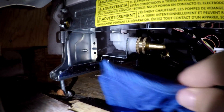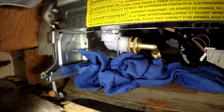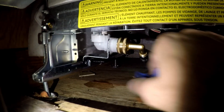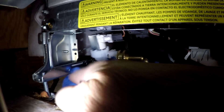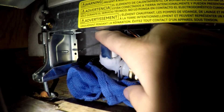Oh shoot, it's leaking even more. You can see it's coming out of the top there. It's kind of like an electric solenoid valve. I don't want to let it run too much, I'm going to go quick turn that off. As soon as I turn the water off, it stopped leaking. There's a little drop there. So I've already unscrewed this right here — this just lifts off and comes down. As you can see, there is no water coming from here; it's coming from right up here.